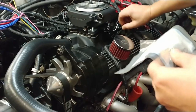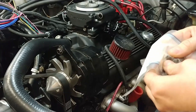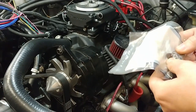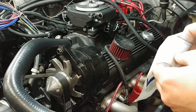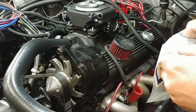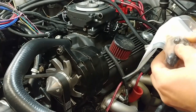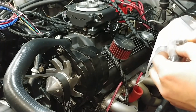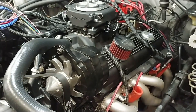spring that will go on the TV cable itself with a little fitting that slips over the cable that the spring locks into. So it has tension at idle on the TV cable, so you're actually getting, I guess, pressure through the transmission properly. And then when it's fully extended, you've got a spring to kind of make up the difference between the full travel of the TV cable and the accelerator cable. So I'm going to put that on before I forget.